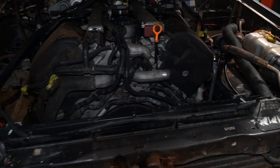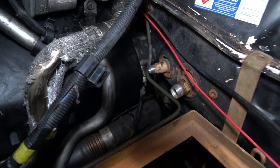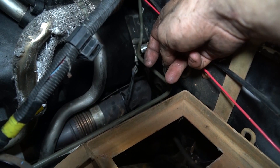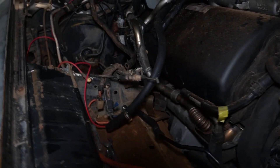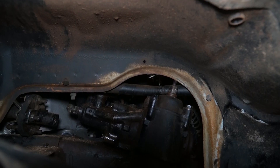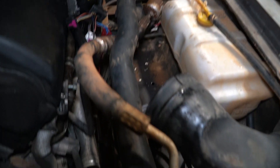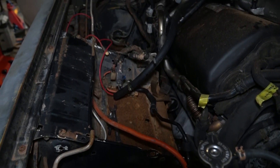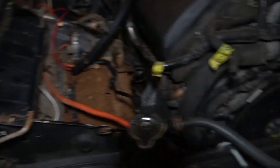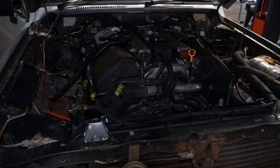Now, without sounding like Captain Obvious, there's a lot of work left to be done. Obviously I'm limited on space almost everywhere. I've got to do a bit of massaging of the firewall behind there — not much. There's a couple of millimetres gap there, so I need to make it at least 10 millimetres to get engineered. But I'm going to try and make it a bit more than that because I want access for tools and stuff. Ideally I'd like to move the engine forwards a little bit, because it seems to be sitting quite far back and I've got the space. The steering linkage is going to work because that's not touching on anything. And the sooner I rip out all the crap that was originally in the Patrol — the dashboard and everything — I'll have much more space to work with. Because these cars don't have a battery in the engine bay, I'm going to have all of this space as well. So I'm going to cut this stuff out, rip out all the Patrol wiring, take the radiators off, and then hopefully I can have this engine permanently mounted along with the gearbox mounts, and this project will actually be able to go somewhere.